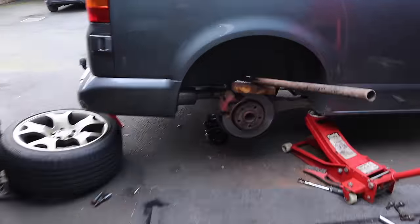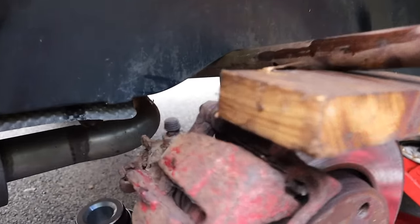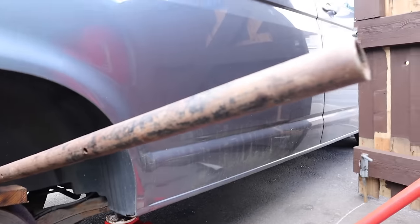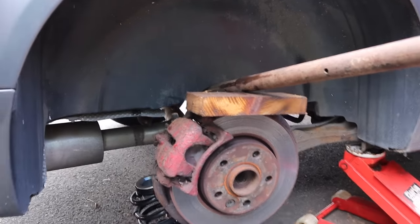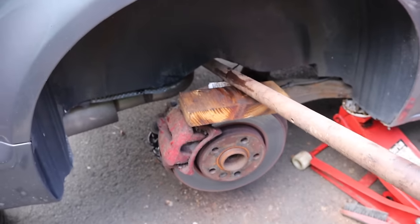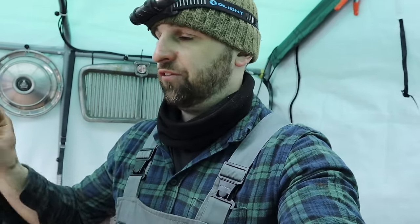The way I ended up doing it was a block of wood on top of the disc to space it up so it doesn't hit the back plate, and then a bar under this curved part of the chassis. You can hang weights off the end or if you've got a second person just to push down, you can literally just drop the springs in. If you have got someone who can just do that for 30 seconds, it's a massive advantage - saves you all the hassle. I definitely recommend getting somebody - your neighbor or anyone - just to help. It's a big difference.